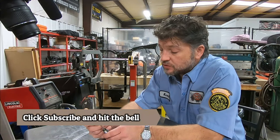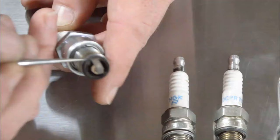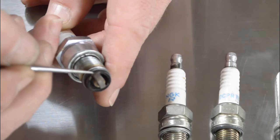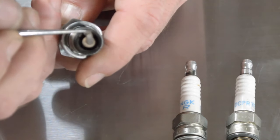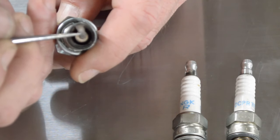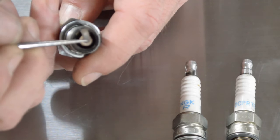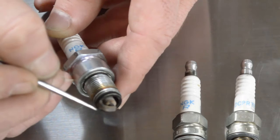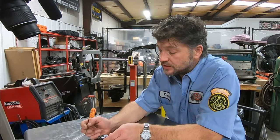What does that mean in detail? If you notice this gray color — or even a blue color — and it's all the way down here at the threads, at the very base, that's telling you you have too much timing. If you see that color change closer up here to the tip, that means you don't have enough timing. The goal is to either advance or retard timing so that you get a color change right in the middle of that bend, and that'll help identify your proper ignition timing.